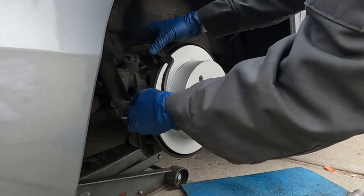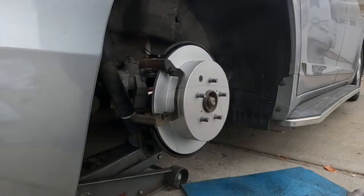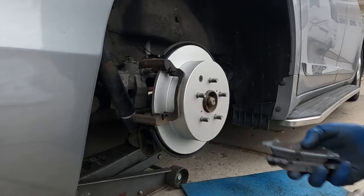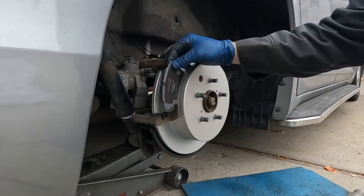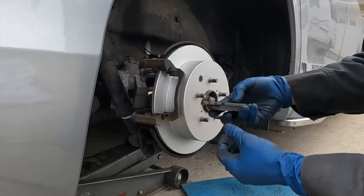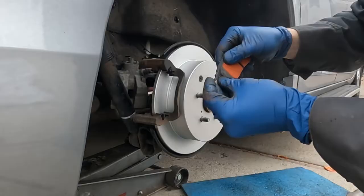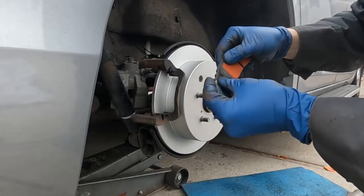Go ahead and put our caliper bracket on. Now we just want to make sure that none of these clips are hitting or rubbing on the rotor, otherwise that'll make a nice high-pitched squeak noise and we don't want that with our new brakes. Now with these pads, you have to install the little wear indicator. Looking at how it's going to go on, the wear indicator goes on the bottom — just clips in. Yours might be different though; each manufacturer does it a little different. This one's going on the back side, so you want to install it again on the bottom.